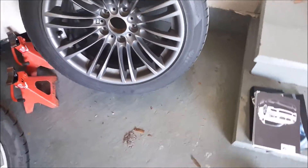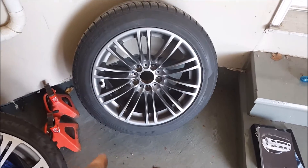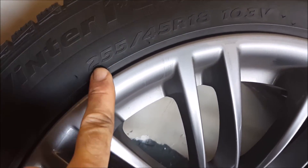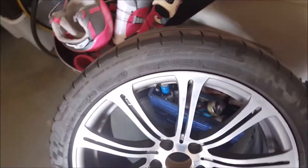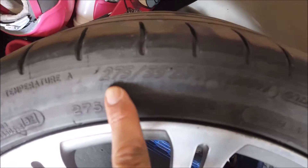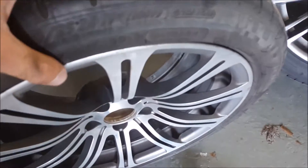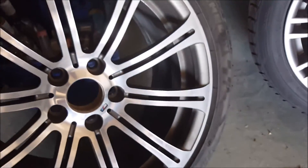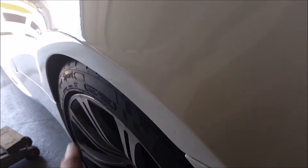Conventional thinking says that an 18 will weigh less than a 19, and they should. What I did when I put snows on these factory 18-inch wheels was I went a little bit smaller. You can see these are a 255 section width, and on the 18 rears it normally calls for a 265. So these are about 10 millimeters smaller than stock. And on the summers, I went 10 millimeters wider to a 275-35-19, mostly because I think BMW stretches their tires on the rims. When you put on a 10 wider piece of rubber, it tends to fit nice and flush and looks a lot nicer on the wheel. In my opinion, you can see here, this is a 275, I just put it on — it's nice and flush. Whereas if it was the 265, it kind of buckles in just a tiny bit, and I don't like that look.